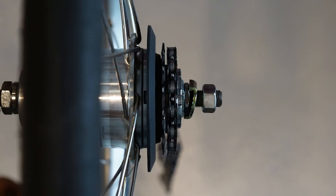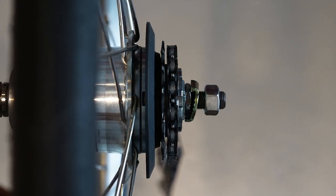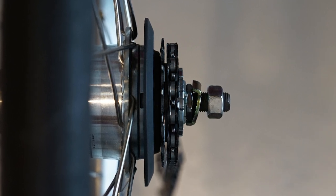Here is a picture showing what happens when you slap an 11-speed chain onto an original Brompton sprocket set. You can see the gap. That's the gap you want to avoid. When you press the shifter, the chain pusher pushes the jockey wheel, which guides the chain from the small sprocket to the big one. When shifting from faster to slower gear, the chain tries to climb from the smaller to the bigger sprocket. If there's a gap, that gap may be a bridge too far for it to climb. Some riders can live with the clicking — maybe rotating the cranks four times will eventually get you there — but most of the time it doesn't work cleanly.